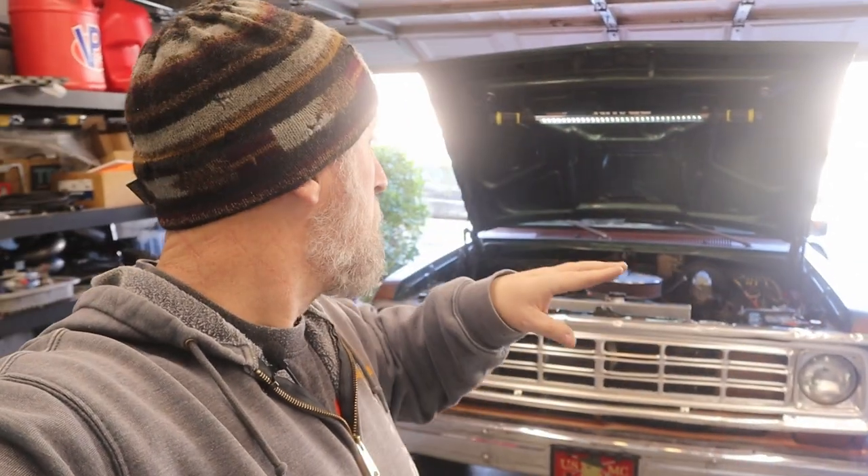With everything loaded back up the truck is running really well. Idle is still searching a little between 850 and 900 RPM, but the air/fuel ratio is perfect and it doesn't seem to be running as rich as before. There's still a small exhaust leak on the passenger side — probably a clamp between the header and collector that needs tightening. Overall I'm pretty happy with how she's running. It'll probably need more fine-tuning, but this is a good step. Thanks for watching — hit subscribe, hit the bell, and I'll see you on the next one.